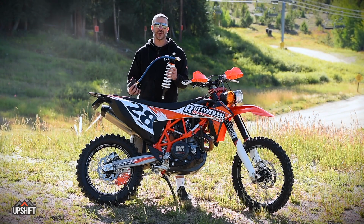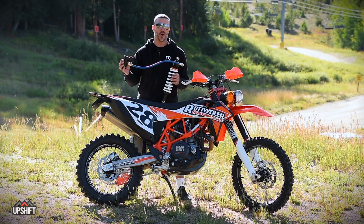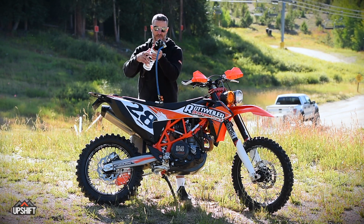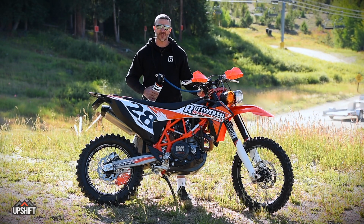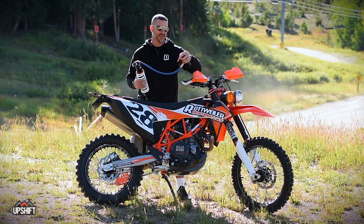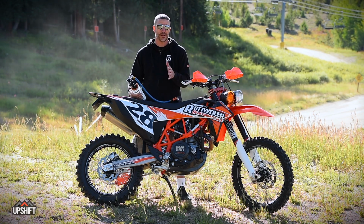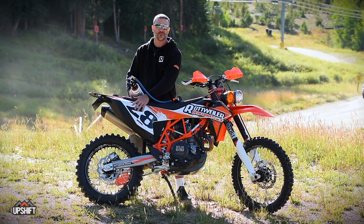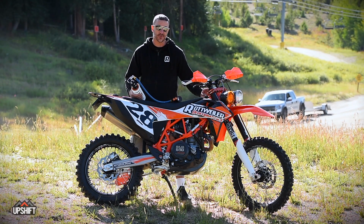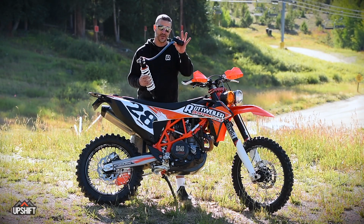So what I've got in my hands here is a tractive rear shock, modified again by Conflict Motorsports, and we had to do a remote reservoir on this because it just wouldn't fit in this 2019. So the great part about this is we can actually mount this and get the reservoir up front. So in phase 2 on this motorcycle, what we're going to do is get the adjusters on some knurled knobs, and we'll be able to adjust the rear suspension on the fly, which is really important on this bike because the gasoline is consumed from the rear and it changes the sprung weight. So we'll be able to reach down and dial it in because we've mounted the reservoir up front, and it'll also get cooled a little bit better.